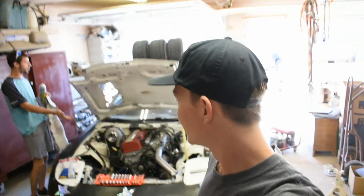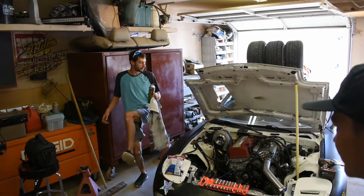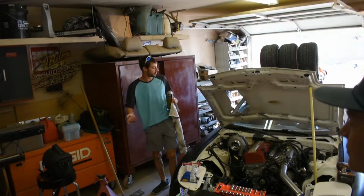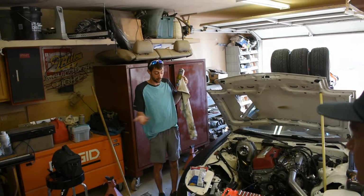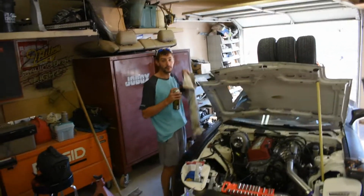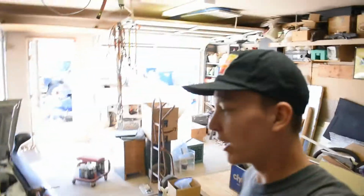Pretty chilling. We got an oil leak and I want a clutch over limit, a bump stop on my clutch pedal so it doesn't over traverse. And we're there. The car's driving pretty good. It overheats a little bit sometimes, but it's a little warm here out in Arizona. But we also have a small radiator. Kind of goofed ourselves there. So we're gonna clean off all the oil, reseal it. We think it's coming out of the VTEC solenoid. So we're gonna get going on that, and we'll check up with you in a minute.